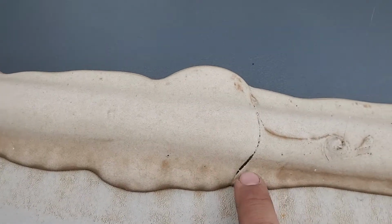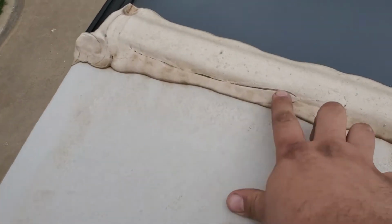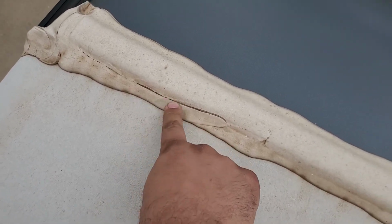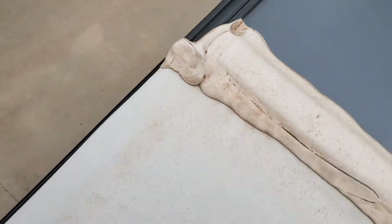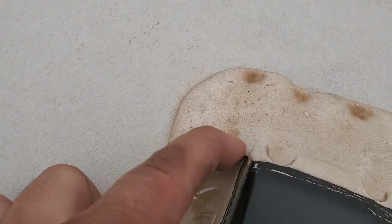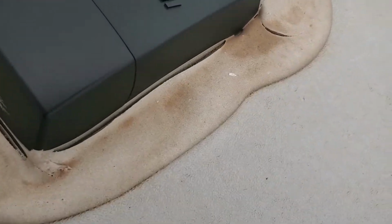My front cap got holes in the sealant, splits in the sealant. On this side, anywhere that looks like they ran 2 different beads of sealant, it split in between them. So that's all split there. Brand new camper. Brand new. On my solar ready thing, all the sealant's all split around here. Brand new camper. Brand new. Not even 2 months old. A couple months old anyway.